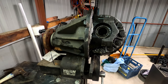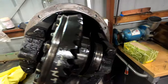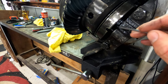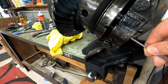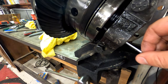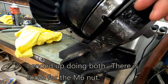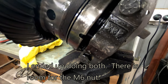I've just chucked up the second-hand diff centre I brought, in the vice - you can see the wreckers tag on it still. My last one died because this little screw came out and allowed the lock ring to turn - it had come out just enough to do that. So I grabbed my Allen key, and look at this - it's exactly the same on this one. It's just sitting here finger tight. How many other Ranger diffs are sitting exactly like this, just waiting to fail? Absolutely, this is a Ford problem. I'm going to stick a lock nut on here - I've got a bit of room. At least I'll clean it out, put some Loctite in there and retaining compound so that doesn't happen again.